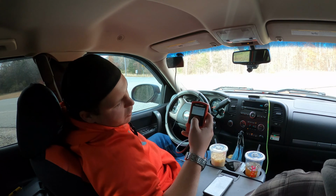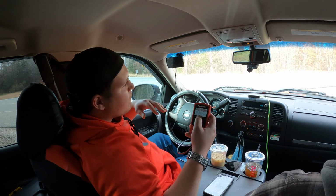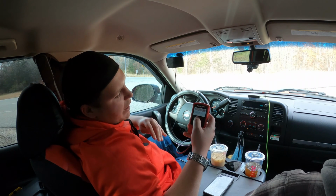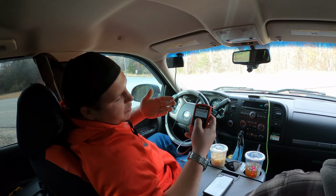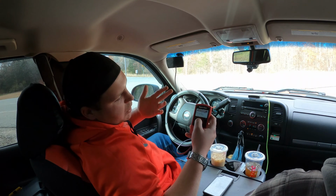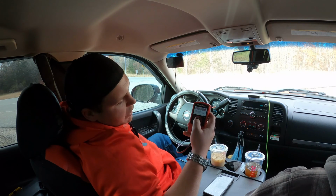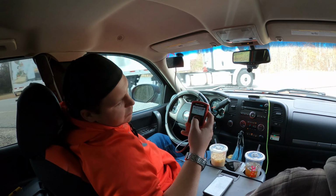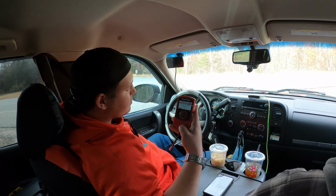And then the shift torque. That is on your shifts, if it's gonna limit how much power it gives you during the shift. That one you can adjust as well, 75%. There's a bunch of options, 125, 150, max value, stock value. We're gonna leave it right in the middle at the Superchips value. So then we're gonna go down to continue. And now it's gonna go ahead and tune this thing.